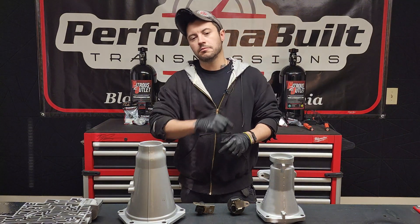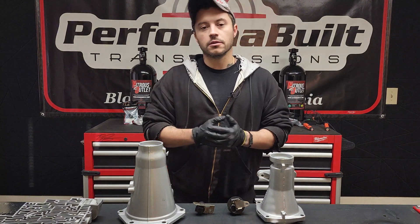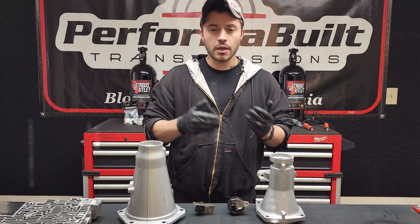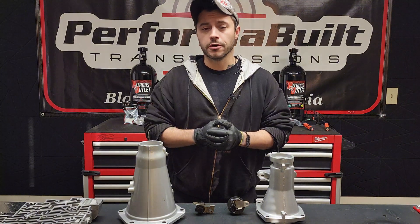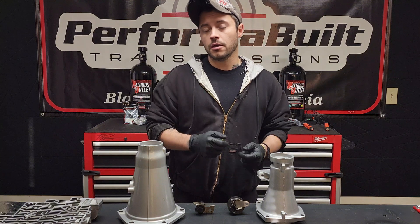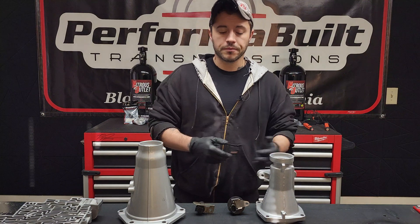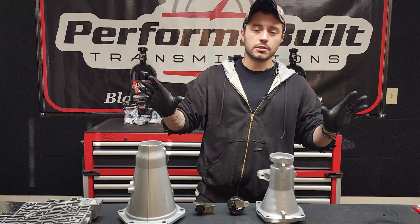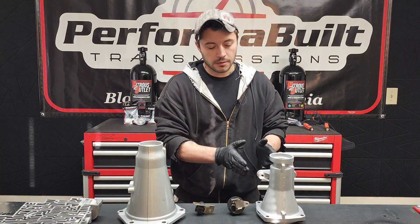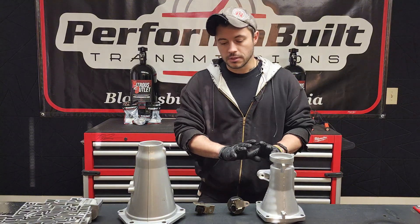The 60 — this is where most people can't find the answer. When you buy a controller or standalone system, this is especially important. They're going to ask you when you order a controller what side the speed sensor is on so they can get your harness right, and what type of speed sensor it is. This applies to the 4L60E and the very late model 700R4 that had an electronic speed sensor, as well as Corvettes.